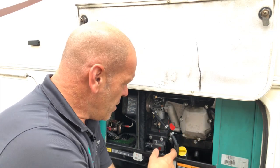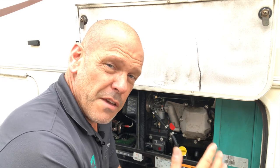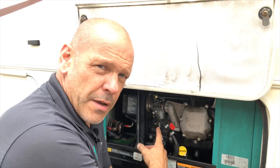Okay, so before we get started, I just want to make sure that you've already checked you have enough battery power, we've got fuel coming through to the carburetor, you've got a spark, and nothing's blocking the air intake. If not, check out this other video up here, because that goes through that whole process. If you've made it here and you know you've got all of that working, then let's get this off and check it out. It could be the issue. And as always, if you're not sure, start with the cheapest item first and work your way up.